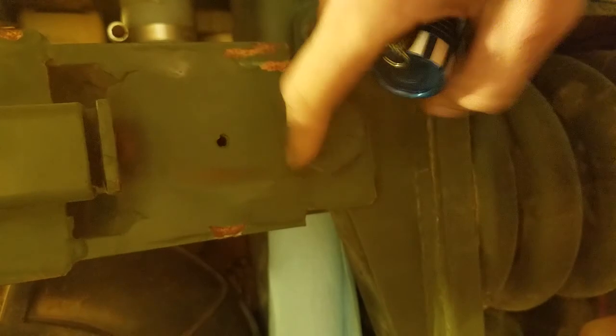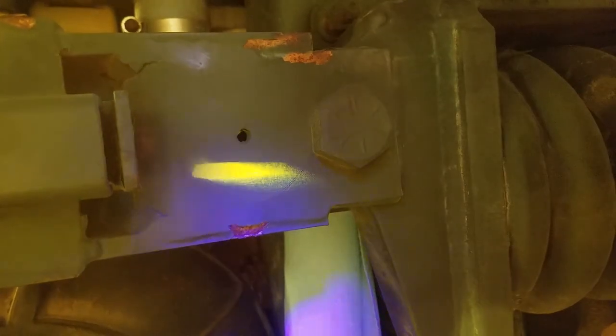But kind of cool. It doesn't show up all that well here, but this dye really works. I'll give you a great example. See that little streak? Right here. It just looks like something normal until you hit it with the UV light, and then you can clearly see. What I did is I just grabbed a little fingerful and wiped my finger on it. That dye stuff really does work. But there it is. Oil came through, but no luck on getting it freed up.